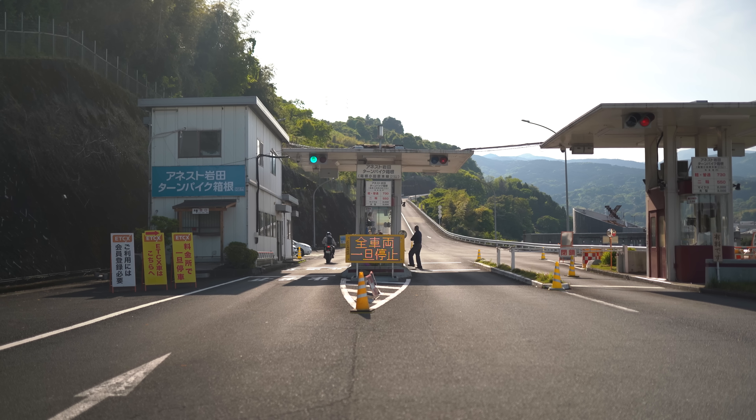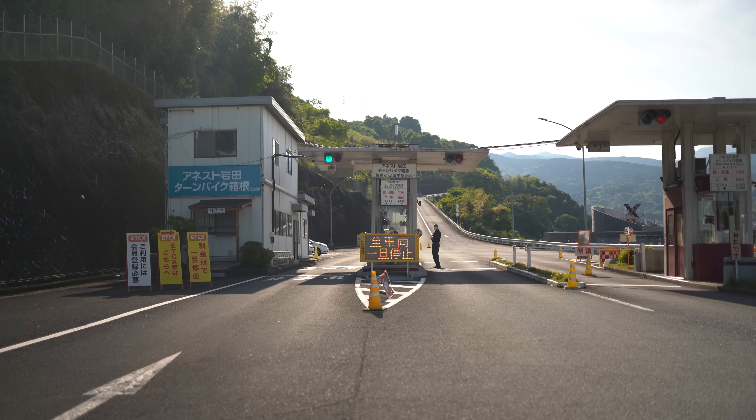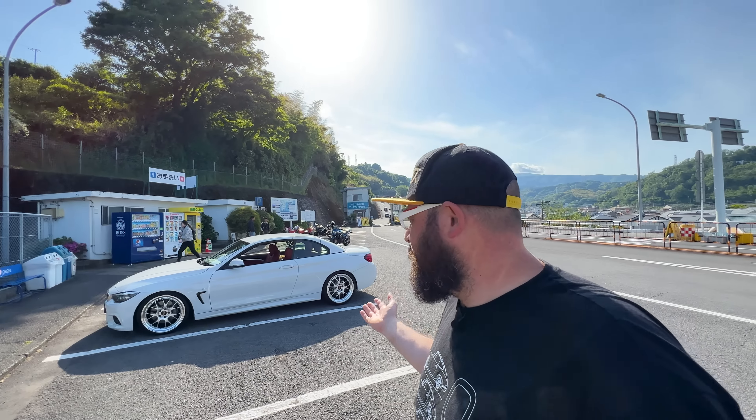So we've measured and had a look at the rear — it was sagging a bit too much. We're doing it with the roof folded and closed in the trunk so the car sags at its lowest point right now. We're probably lifting it 10 millimeters, keeping in mind that with rear seat passengers it squats a bit more. Wheels off again — we've actually maxed out as high as you can go in the back, so this will have to be it. I honestly think it looks perfect; it's a bit lower than the black car but not much different.